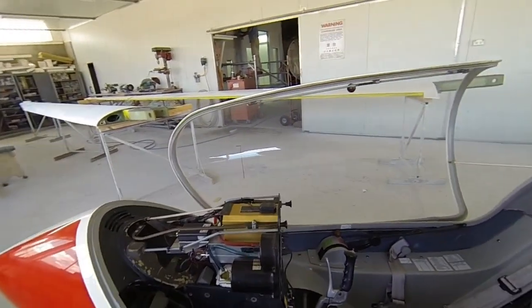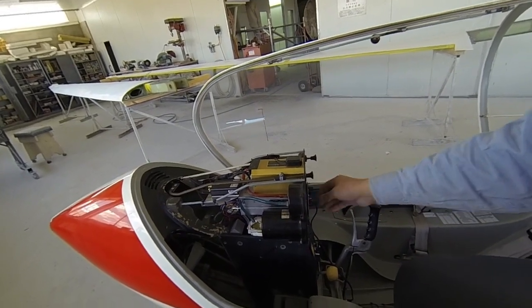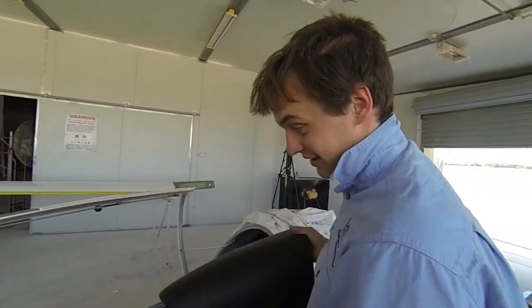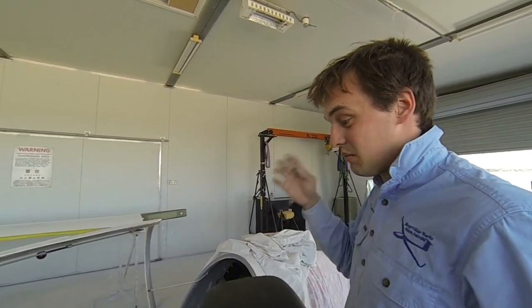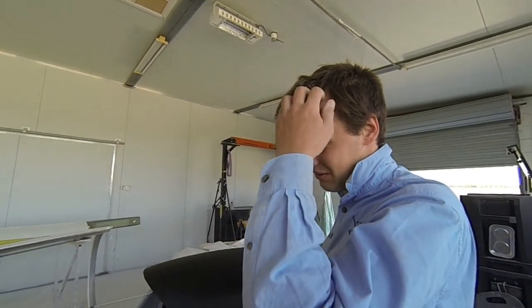The noise you were getting — what was that referring to? It was like an electronic noise, interference with the radio. If I turned the radio on with the squelch on, it was just a constant noise. We said it could be the fact that it's an automatic squelch adjustment with no manual knob on the radio — probably an older generation radio not designed to cope with this sort of technology. We got a proper aviation filter off Aircraft Spruce, and that helped a lot. A normal everyday one was no good, but the proper aeroplane one did the trick.